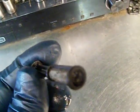And yeah, so there's my tensioner. Had all this apart. This was very difficult to get to, by the way. Oh, and I haven't made a video about this, but I took that power steering pump off back there, and then there's a screen in the back. And this is another thing that led me to check my oil, which should not have gotten dirty within like a week or so of changing it. I don't know if this will show up on camera, but this is the screen, and it looked like it was at least 50%, if not more, filled with metal particles, not just sludge.